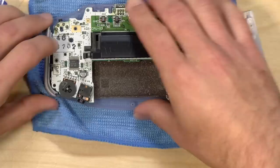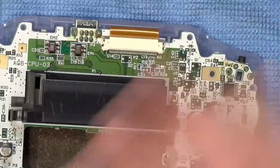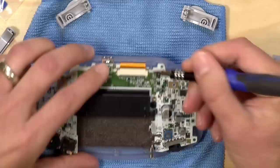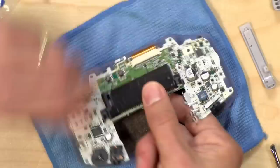We're going to pull out all the buttons and the little side pieces so we can more easily work with everything. The motherboard should just lift right out. At the top, I need to disconnect the ribbon cable. There's a '40' marked on the right-hand side, meaning I've got the 40-pin connector — so I'll use the longer 40-pin connector for my screen when ready. I release the ribbon cable by pushing the two little plastic gray things up using tweezers, being careful not to scratch the motherboard. Now we've got the motherboard detached.